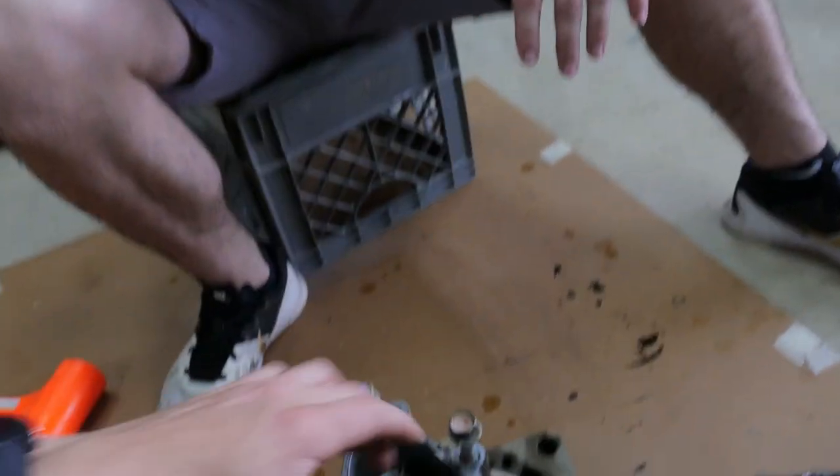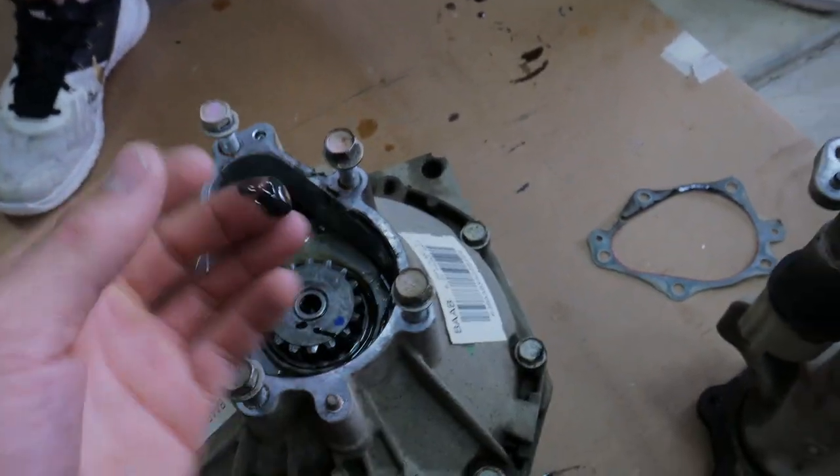So, I mean, how was the fluid when you drained it? So, everything in here looks good. We got a little black, but anytime you have metal on metal, you're really gonna... It just wasn't the greatest color, but there's no metal flake. I didn't really see any sparkling, check my flashlight. Nothing looked terrible. So, looked like it was in decent shape. So, I have a feeling nothing's broken internally. We just probably had a leak in that gasket.